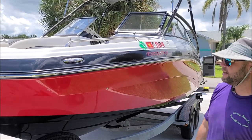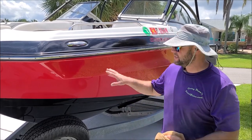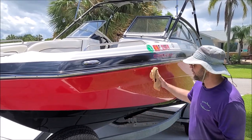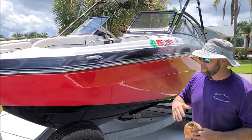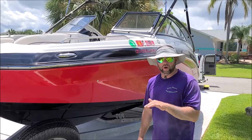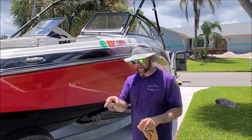You can see how nice and bright that black is. For this detail I'm leaving it right there. Generally, if it's a higher end detail — but this is a prep for sale, nothing fancy — just trying to get the oxidation off so it looks glossy so they can maximize their trade-in value or whatever the situation is. I just wanted to give you guys that demo of the Gel Coat Oxidation Eater compounding polish because it is fantastic. I do have a more aggressive compound for gel coat in the works, however it won't finish quite as good.